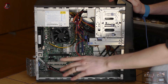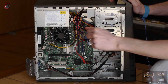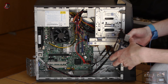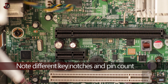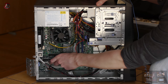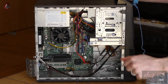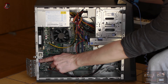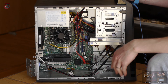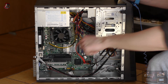First make sure there are no cables or other hardware in your way, and remove the pieces covering any back slots. Then take the card by the sides and lower it into the PCI Express 16x slot — it's a black slot about the size of a standard PCI slot. My case uses tool-free access, so if yours does too, great. If not, make sure you secure the card with a screw at the back. Screws like that usually come included with the case.